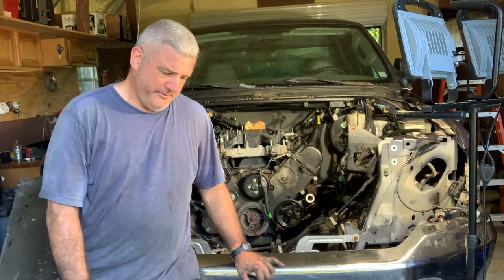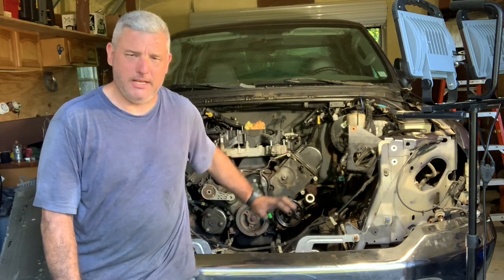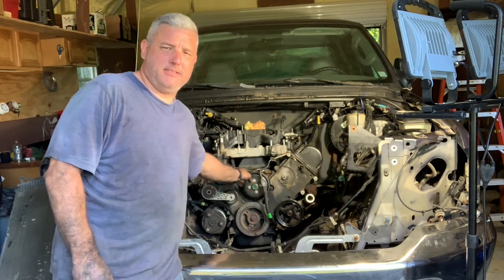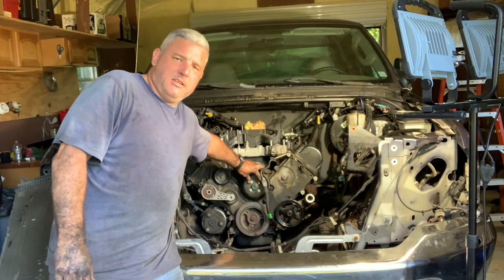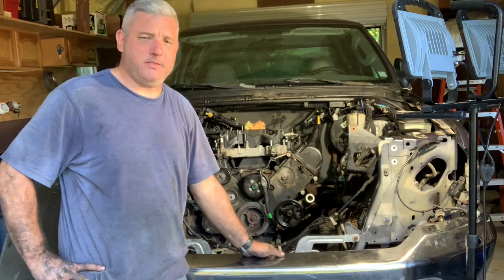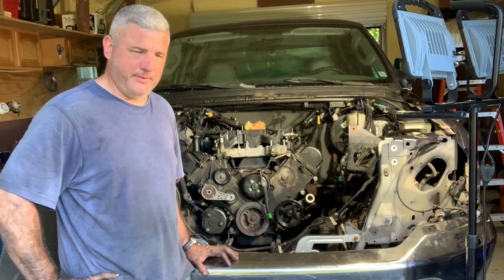Day two is complete. Feel pretty good about it. I had an early struggle — for the first three and a half hours I was trying to take the fan off. The fan clutch screws on here, but the thing spins, so you've got to make it immobile so that you can unscrew the fan. Apparently Ford makes some special tool, but I improvised.